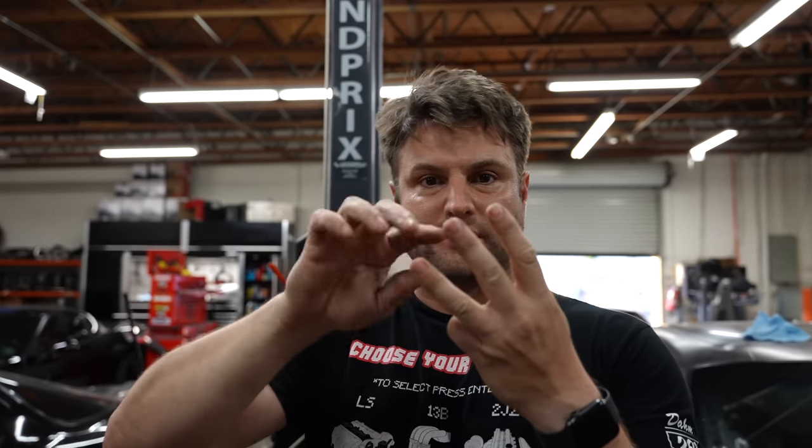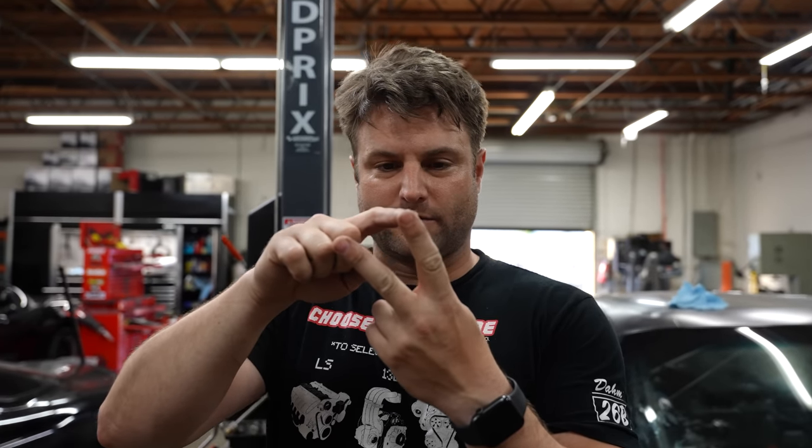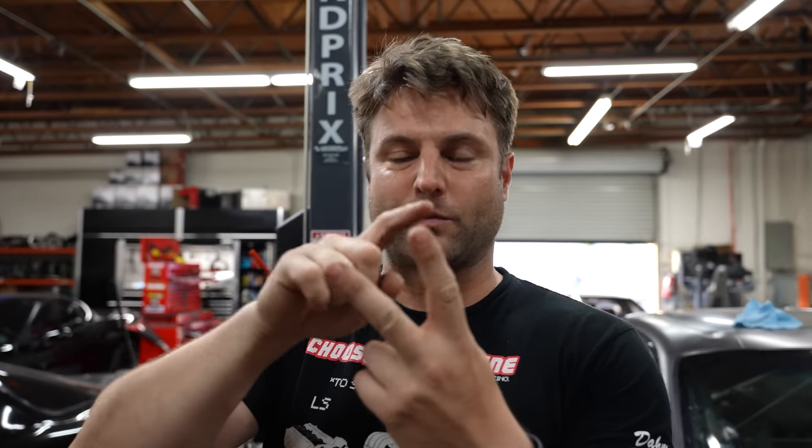On a traditional digital circuit, you'll have three wires: ground, power, so the low, the high, and then the signal that bounces anywhere between those or has a set purpose, right? Well, this one doesn't have those. There's ground and there's power, but where's the signal? So you actually do this. You say, okay, we'll send it power, and this is the signal, but we will also put a resistor. By the way, don't forget about ground. There's a ground resistor that pulls this down. So it says, hey, this is 12 volts, this is 0 volts, and then you fight this. It literally is fighting that resistor to give you a voltage out here. That signal is digital. So all this chaos means a high, a low, a high, a low, high, low.